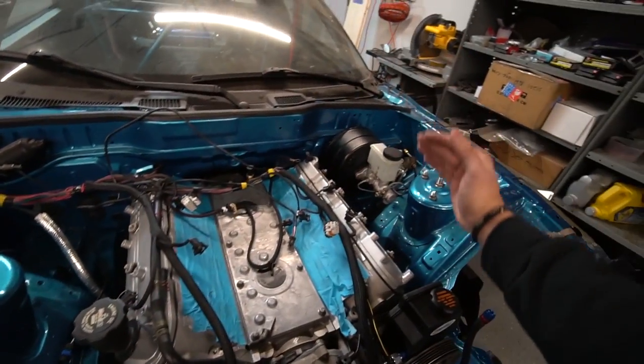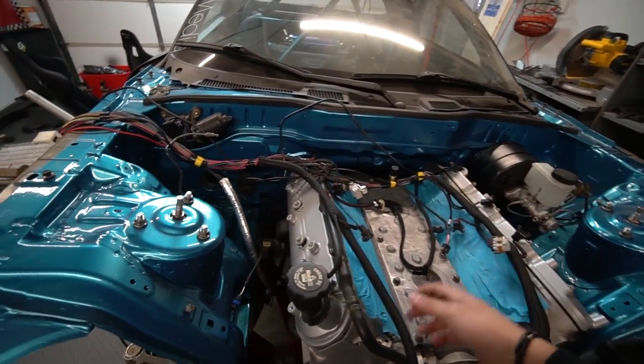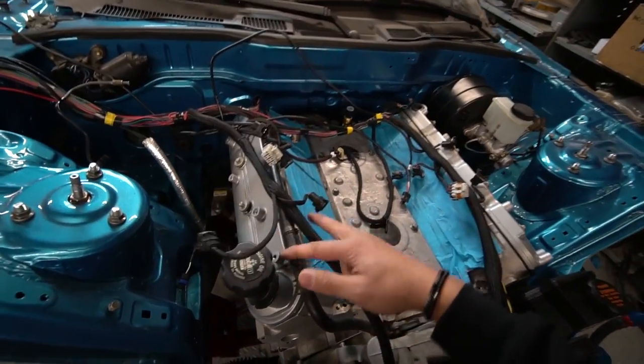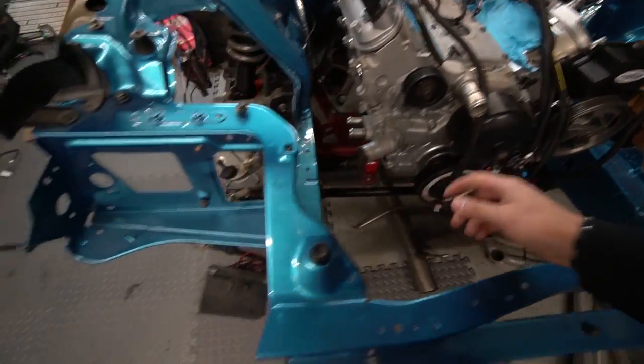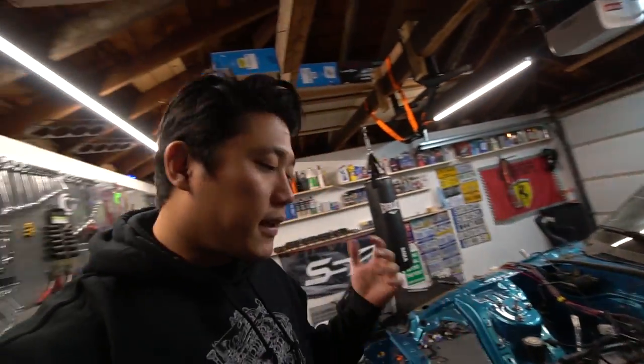The LS engine harness kind of splits into two down the middle, and also splits into two — one on the left, one on the right — towards the transmission for the O2 sensors and transmission speed sensors and whatnot. On the left side you got your connection for the injectors — four on the left, four on the right. You got one plug for the coil packs. I also have power for the fan control with the fuse box right here. In the future I do plan on cleaning everything up and putting all the fuse box inside the car, but for now I don't want to do too much at the same time. When you do that you lose track of what's working, what's not working, and if there's an issue you can't really track it down because you changed so much. You want to change things one by one if possible.